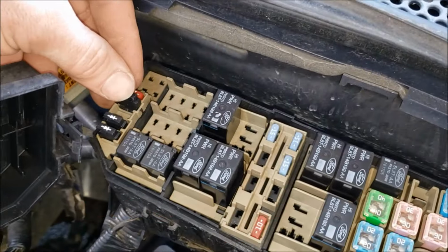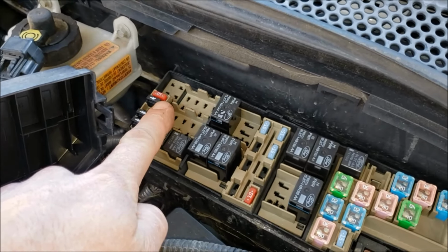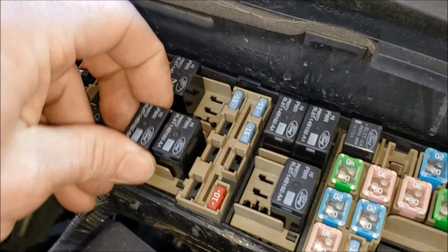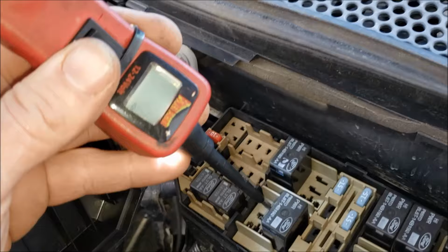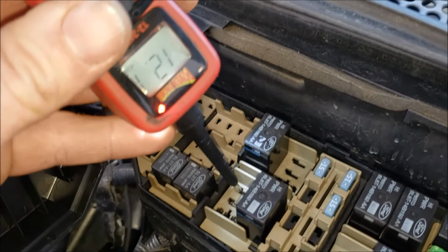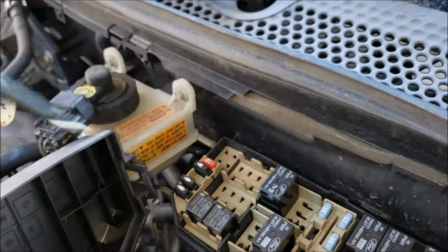Now if that didn't work for you, moving right along, I've never seen one of these diodes actually go bad. Comment below if you have seen that. The next thing you would want to check is your starter relay, and the easiest way to check this would be to pop it out and swap it with another one and try it out. Or you can take your power probe and do a similar test. You can see this side here is 12 volts, so this should be the starter side. That's ground right now. If I hit that, see, there you go, it'll start up.